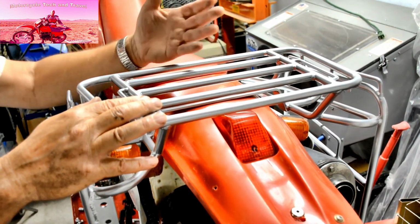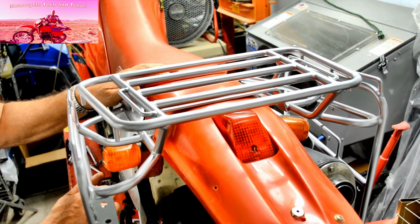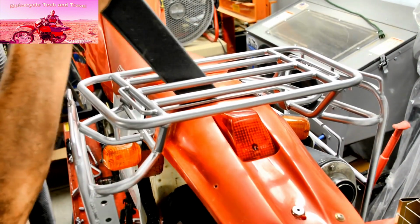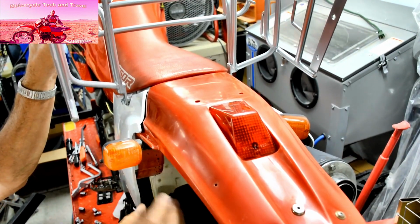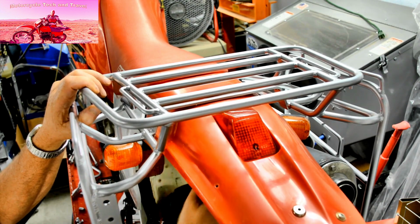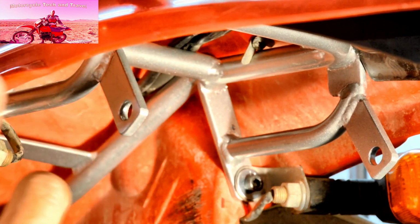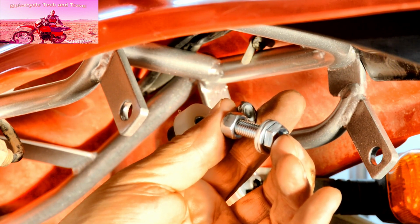When drilling these 2 holes, be certain that you know where the wires are on the underside of the fender. Don't drill through a wiring harness. Vacuum all of the metal, debris, and plastic from the fender, from the bottom side, from your tire, and all other areas underneath. The hardware is designed to pull through the strap and the plate on the bottom side that's a part of the support bracket. In our case, we had wires running between the support bracket and the fender. The hardware furnished with the rack kits is intended to squeeze the fender down to the support bracket.